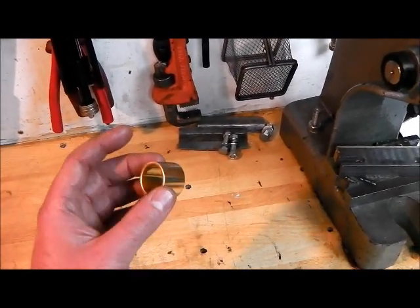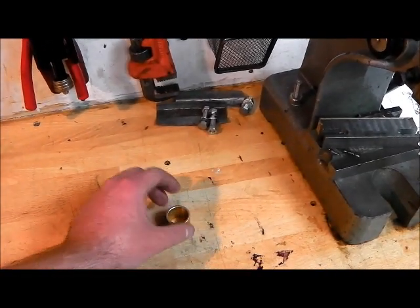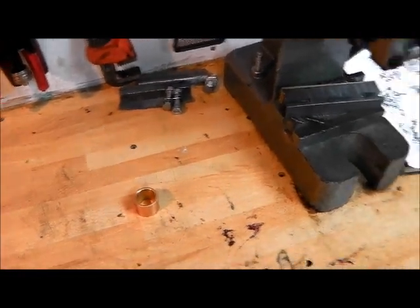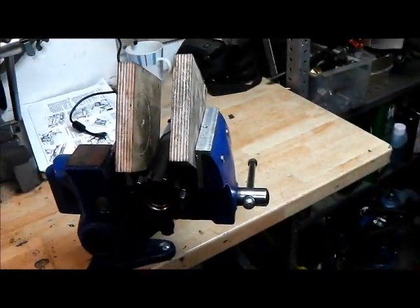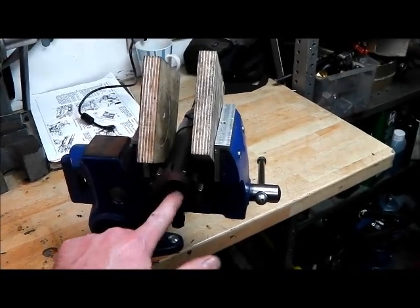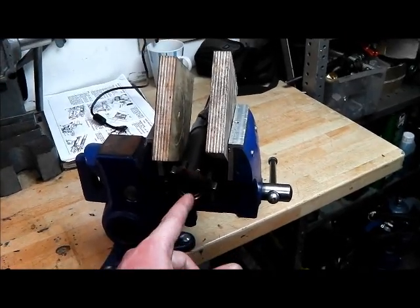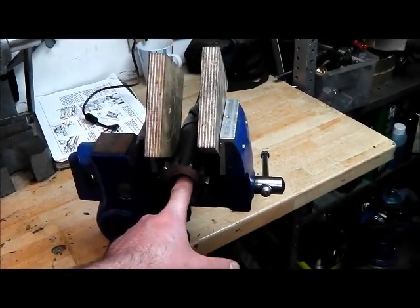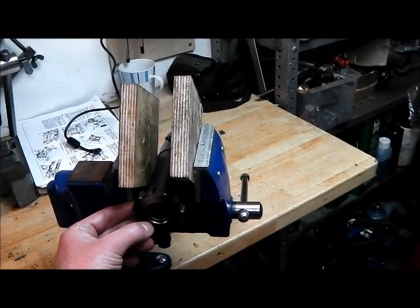This one I've just wiped and cleaned it up but it feels nice and oily. It will just help it when we first hit the road. In the case of the crank spigot it's quite important for the life of the bearing. With the crank spigot you could take this out by filling up that void in there with grease and then driving a tight fitting piston of some description in there, maybe a piece of ground bar stock, to force the bush out.